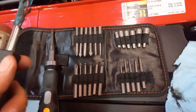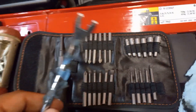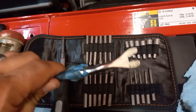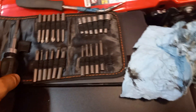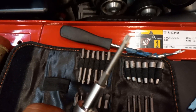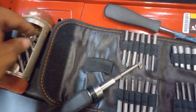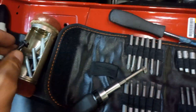By the way, if you're looking to swap throttle bodies or clean your throttle body, tools you're going to need: you might need one of these push pin forks — there's a little Christmas tree on the throttle body. Aside from that, it's a Torx T25 for the throttle body, and then of course your trusty 8mm to get the lid off your air cleaner.